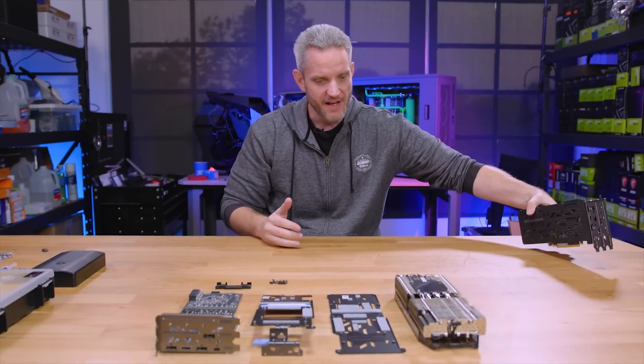It's kind of a stroke of luck, because when everything is in place and I push this down, it sticks really well. You can see that the actual adhesion of the thermal pads is holding the entire weight of the card. This is my $17 water block I got off Amazon — it's copper. It doesn't have an inlet or outlet; it's pretty much just a base plate with high fin densities milled into it. These are the screws that the back plate screws into.